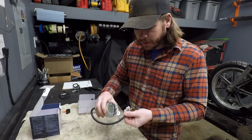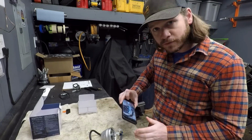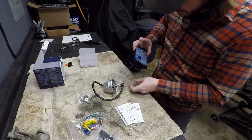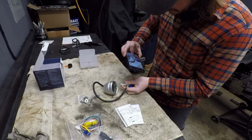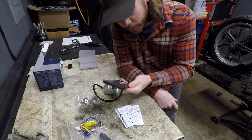For us, since we are going to modify this, a good practice item is to take photos of all of the wiring here. That way, you don't get it all screwed up, and it all goes back in the same place if you do repin it like factory. If there's 1,000 photos on my phone, 900 of them are motorcycle things like this.